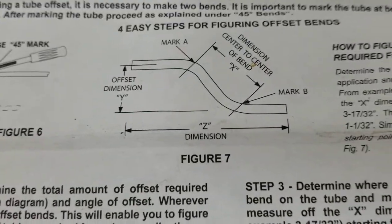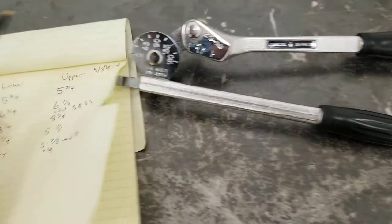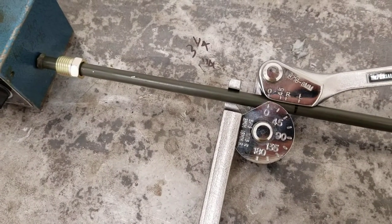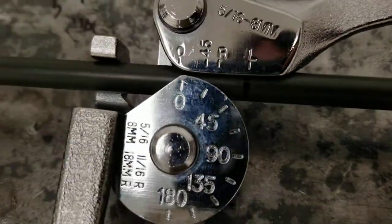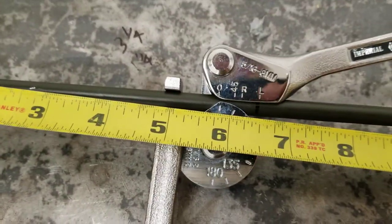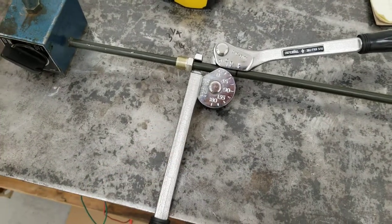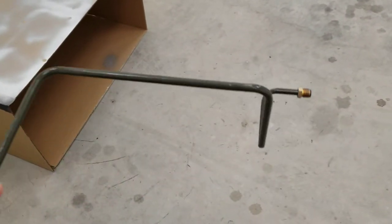Using this table you can make all the bends you want. For example, if I want to do a six-inch bend, I've got this thing rigged up — it's a magnetic base with the brake line pushed against it. I made a little mark right at the L, you can see six and a half inches, and you just go ahead and bend it around. You end up with a piece like this with all the bends — that's really all there is to it.